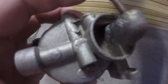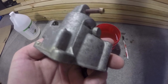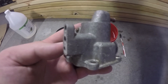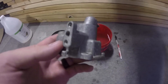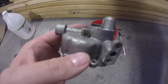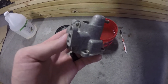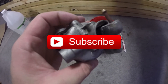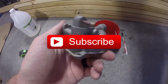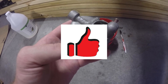I couldn't get the toothbrush very well down in the tight areas. But I think the bottom line is: if you have a carburetor body with zinc oxide corrosion, let it soak in vinegar overnight and then take a toothbrush to it - you should be able to clean it up pretty good. Check out my other videos, they're a lot more detailed on how to rebuild carburetors and lower units on old Johnson and Evinrudes. If this helped you out, please give me a like and hit the subscribe button.